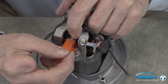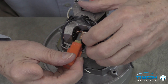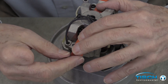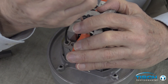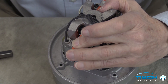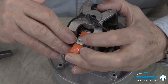Replace with the new motor brush, making sure the brush is in the same position as before. Insert the brush clip under the plastic holder with the flat head screwdriver, and make sure the clip is completely against the brush holder. Be careful not to touch the armature with the screwdriver. Reattach the brush hold-down bracket with two bolts and make sure the bolts are secure.